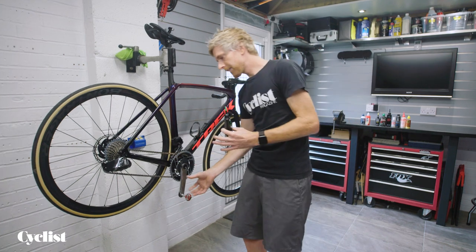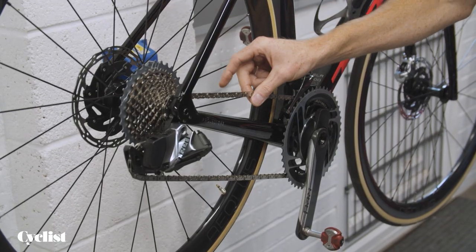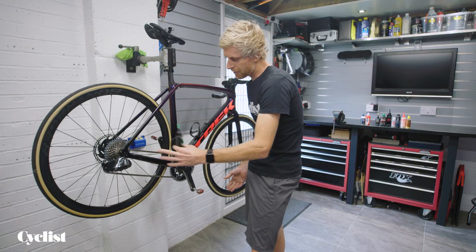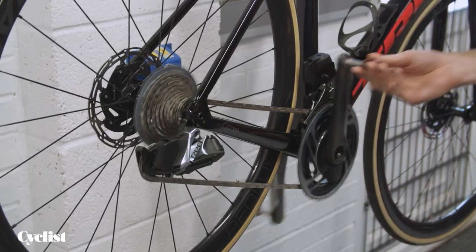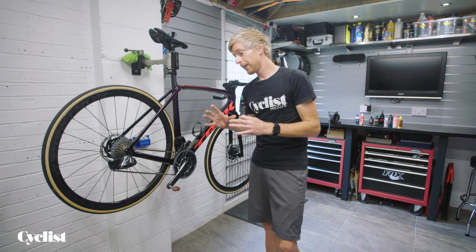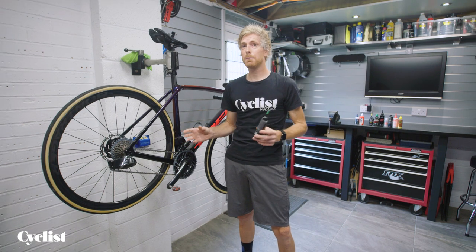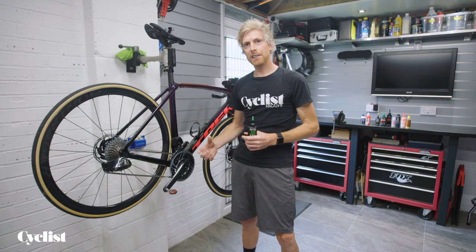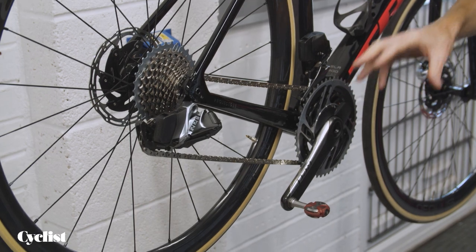From here, the next thing is to keep rotating the drivetrain — you need to let that chain lube work into those links. And another really useful tip is to not then just go straight out and ride your bike. Oiling your bike chain is best done probably the night before you go riding, or the day before even. So if you're planning a big ride on a Sunday, get your cleaning done on a Saturday and your chain lube applied. What you really want is that oil to spend some time penetrating into those links and settle in there.